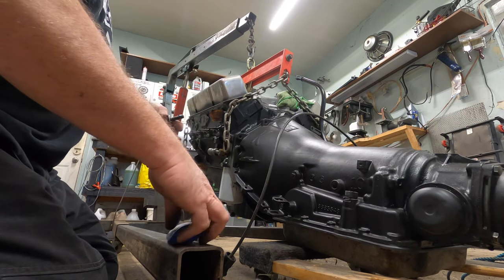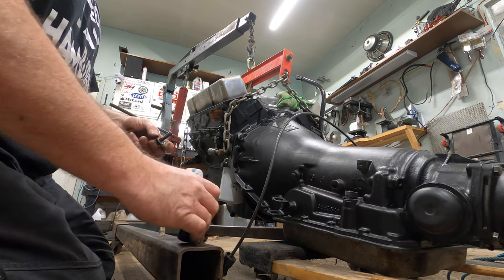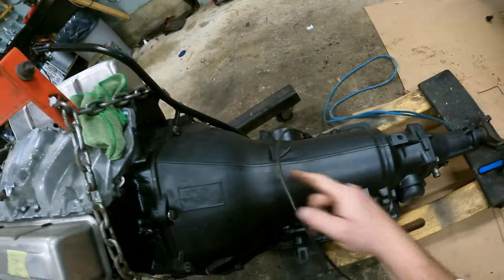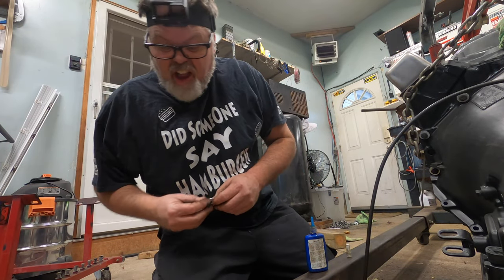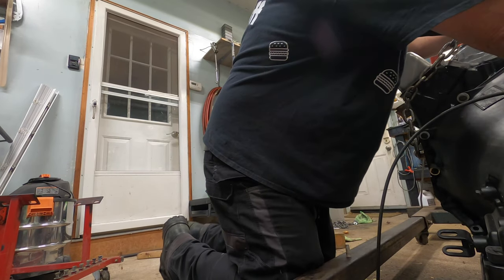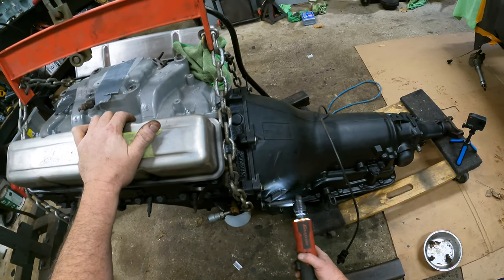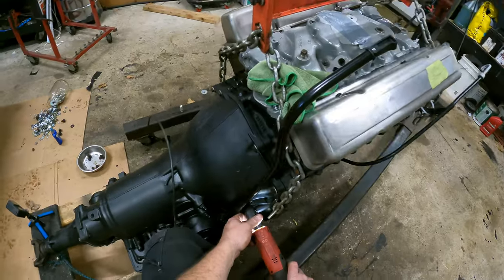A little bit on here. In the hole it goes. Perfect. Down here. Perfect. Don't forget to stick your dipstick in first. Always stick in your dipstick, Captain. Never leave her half out. One more. There we go. They're all started. So now we can snug them up with the old 1000 here. You just want to snug them, because you can actually bust the housing on the transmission pretty easy. Let's bring her nice and slow.